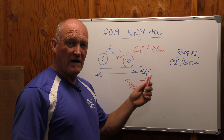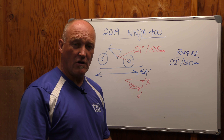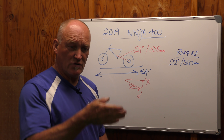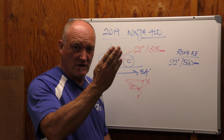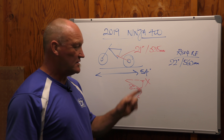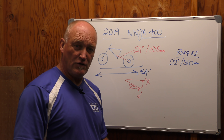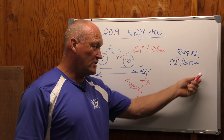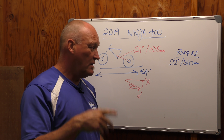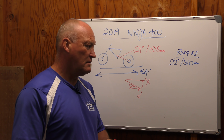So the handling issues you can get — obviously if you've got a short wheelbase with a ton of horsepower, you can spend all day at 11 o'clock. Great if you want to show off, but miserable if you want to ride, because every time you touch the power it's going to lift the front wheel. Bear in mind what you have. Take a look at what your wheelbase is. What is your actual swing arm measurement? What is your swing arm angle? Are you in the ballpark? And if you're going to change to do something like track work and you're moving the axle forwards or backwards, you need to understand the repercussions of that with your swing arm.